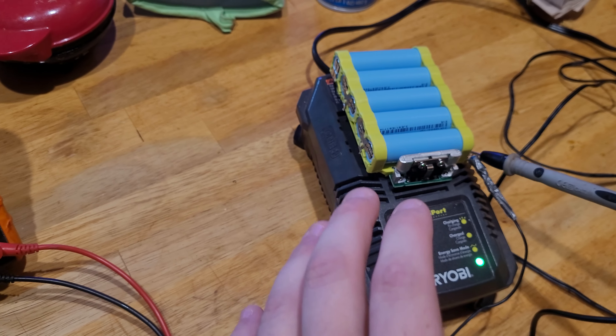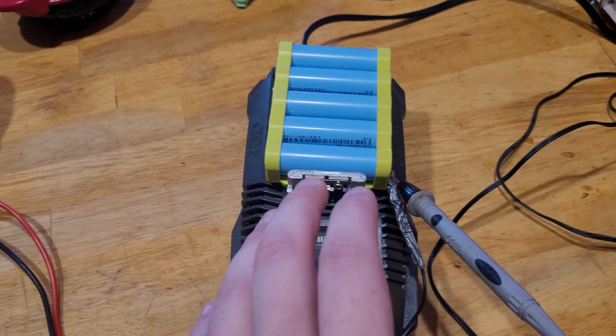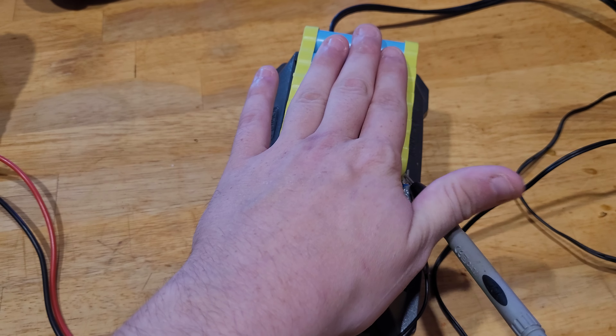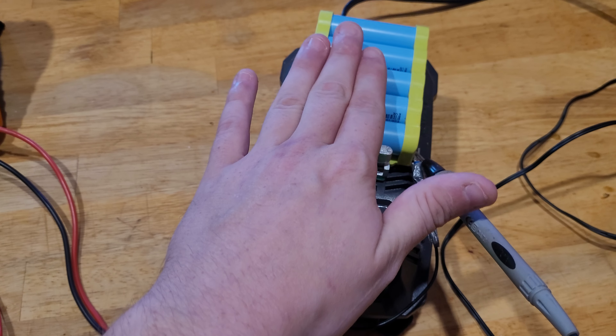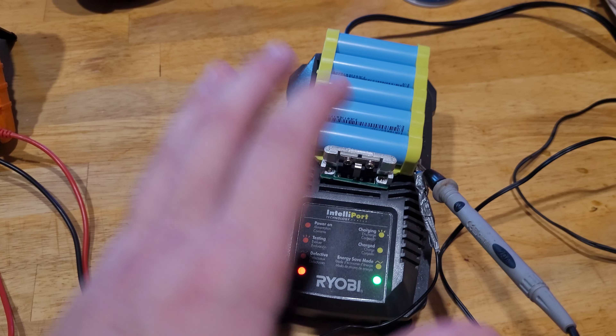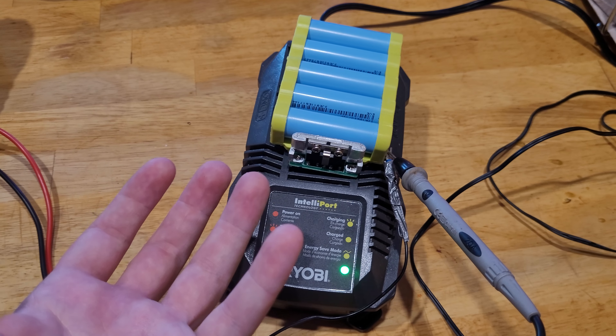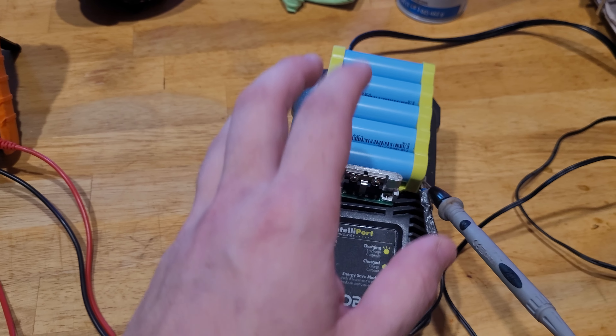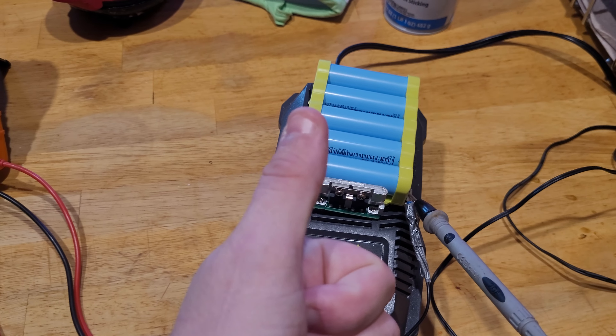Of course, that's just a surface charge on the battery. Now what you're going to want to do from here on out is monitor this battery very closely, because now that you're charging from straight up dead, these will get pretty warm. My suggestion: charge it for about a half hour, take it off the charger, let it cool down, put it back on the charger. If it does the same thing to you again, jumpstart it again, and then you'll be all set to go. If these things are making your hair fall out, don't worry about it — just use this little trick and it should help you out.